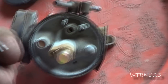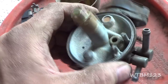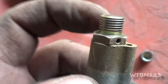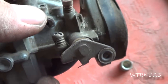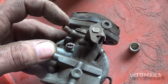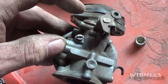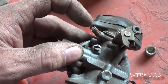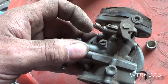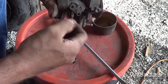Your needle valve is right here. I was kind of suspecting the needle valve might have been sticking or something, which I'm still not sure of. You can see the hole right there in the side — we know that it's open that far. I'll screw this needle jet screw out of here and take that little jet out. On this screw, I'll turn it in until it just touches. You don't want to go past that because it's really soft metal and you'll distort it. Just go until it stops and count the turns. That was one and three-quarter turns, so I can safely remove this now and know where to reinstall it.